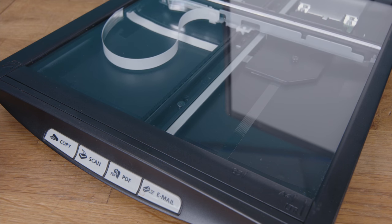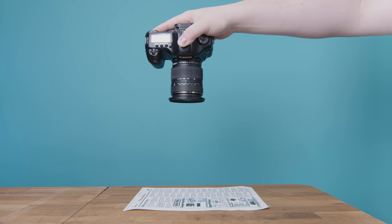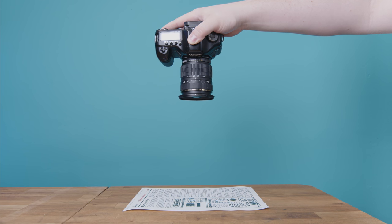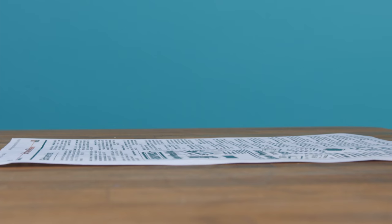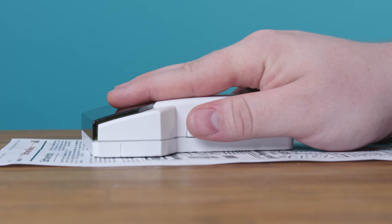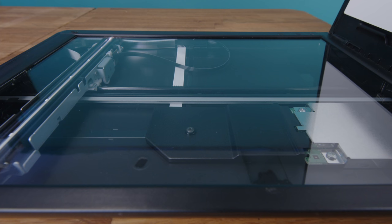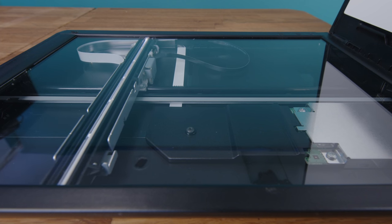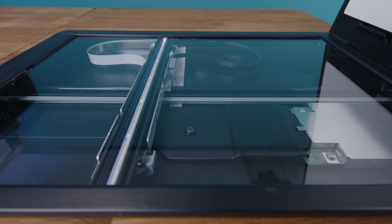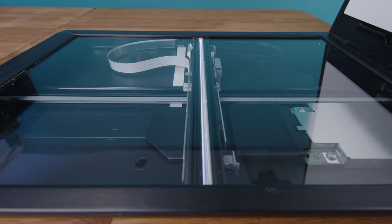To make a complete two-dimensional image, you have to move the sensor slowly, taking picture after picture, and then put them all back together at the end to assemble the completed image. This is a slow process, so these aren't great for normal photography, but for documents they're fantastic. A document camera using a two-dimensional sensor would have to be a foot or two away to see the entire page at once, and it would be limited to a specific width and height. But the linear CCD can be smashed right up against the document, and it can take a scan that's as long or as short as you like. This flexibility is why linear image sensors continue to dominate the world of copiers and scanners.